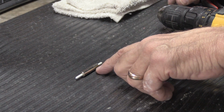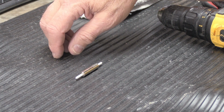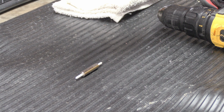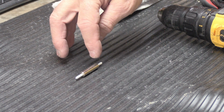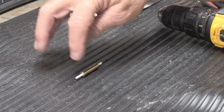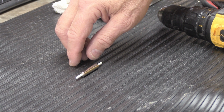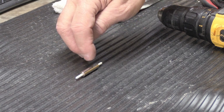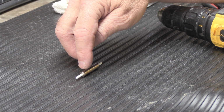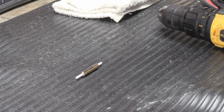This works for all models of door chimes that have plungers which have holes in the end. There are some plungers that they made starting around the mid 80s or so that don't have holes. They have molded on tips on little flanges. I have a video about that. It's a completely different thing. Those can be repaired also, but it's an entirely different process. But this covers a wide range of plungers starting around 1950 and all the way through, say, the mid 80s. So it covers a huge number of chimes that NuTone made.